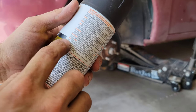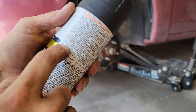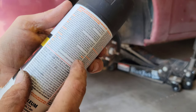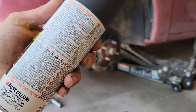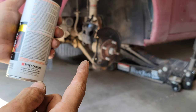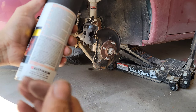I gave it a few coats. Right here on the can, it says on the vehicle, run at idle for 10 minutes, then allow 20 minutes to cool. Run the vehicle at idle for 20 minutes, then let cool for 20 minutes. Run vehicle at normal operating conditions for 30 minutes, then allow vehicle to cool. So just short drives, a little bit of heat at a time, let it cool, and then repeat